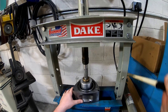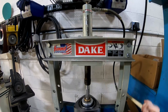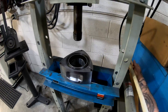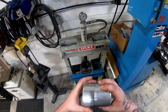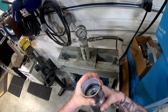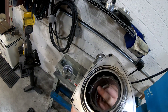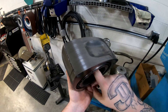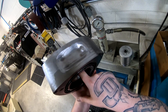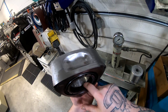Six tons — that's not bad. Between six and eight is stock bearing press retaining pressure. Maybe if I'd let it sit longer — as you can see it's still wet. Some of it seated, some didn't. If I would've left it 24 hours to seat, I would've had a little more tonnage to press it out. But I'm happy with six. Between six and eight is stock; anything above that is perfect.